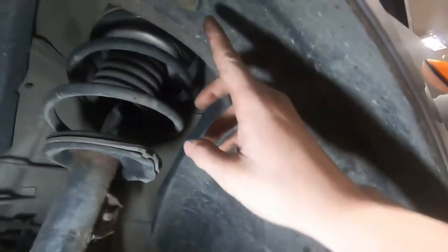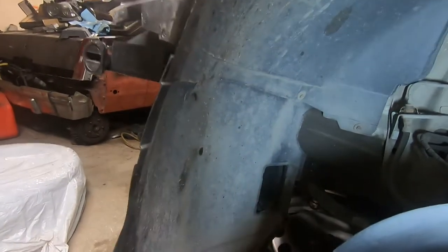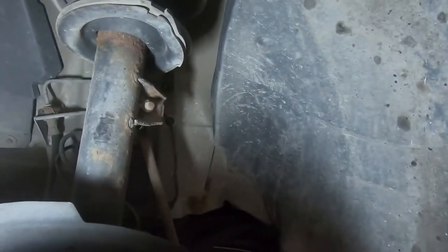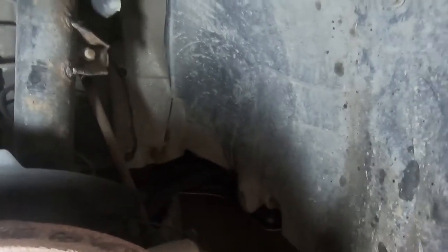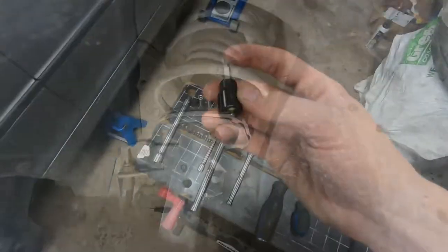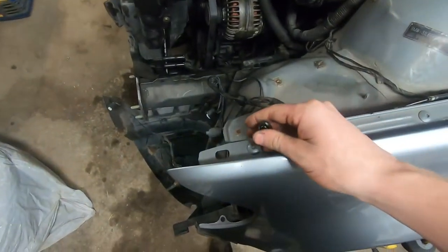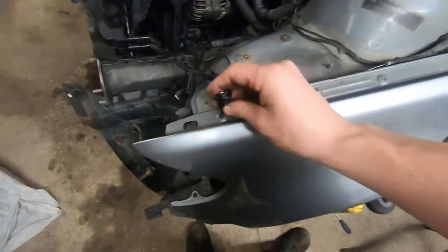In addition to those three clips you have a few up here: one here, one at the top, one up here, and then there's two that hold the front part of the fender. It's easier if you just undo these bolts and remove this separately. There's one more here and one more down on this side as well — so in total about six or seven. One tool I forgot to mention: you need a T30 Torx because to get the upper bolts across the top in the engine bay you need that.